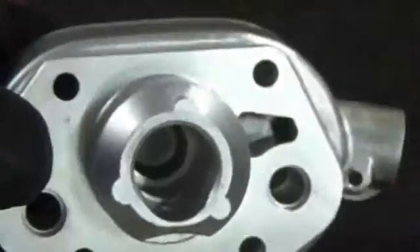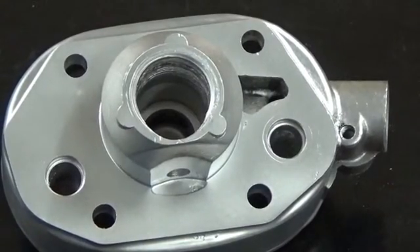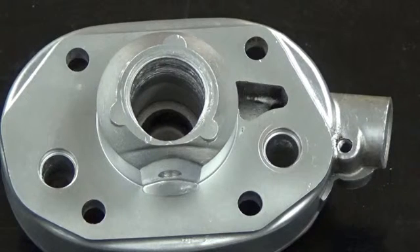Many people know that's a very common issue with the CB350 twin. We were able to remove the RTV sealant, we did not change the sealing surface at all, and we got a really great looking finish — something that resembles cloud silver Honda paint, but it's totally bare aluminum. We did this with a very fine mixture of glass bead and water — no chemicals at all whatsoever. Very easy, very simple, very fast, and very cost effective. Most people are going to be able to go at least a month before changing their abrasive out of the machine.